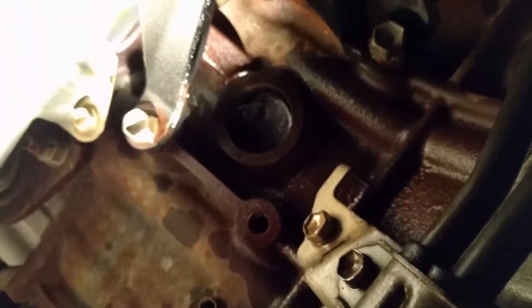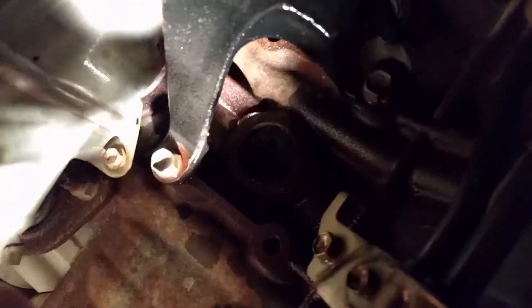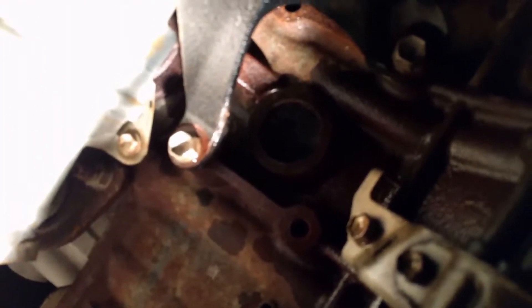Another thing to note: there's your other frost plug. Just so you can see the exact location of this — there's your alternator. Oil pan right above. You should see two frost plugs on the passenger side. This is the rear frost plug that we're taking out, with the best access for the block heater. If you can get your frost plug to look something like that, just chisel up — it'll rotate and then come right out. There's your empty hole where we are installing the block heater.